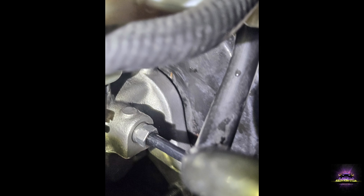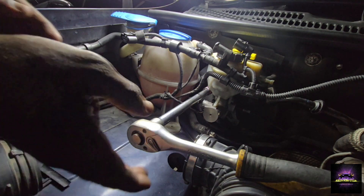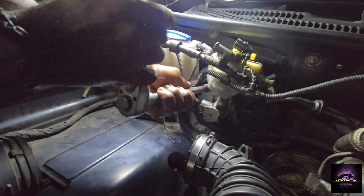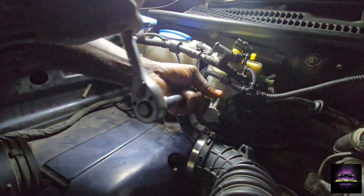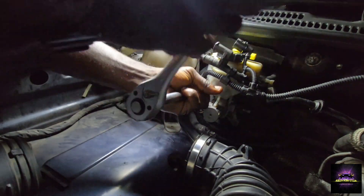The gap is really huge too. I'm not sure who was here before, but it looks like they didn't replace the master cylinder back where it's supposed to. So I'm going to remove it and replace that o-ring behind the master cylinder and seal it back up — and that should be it.